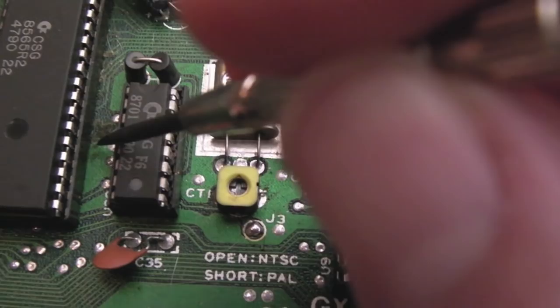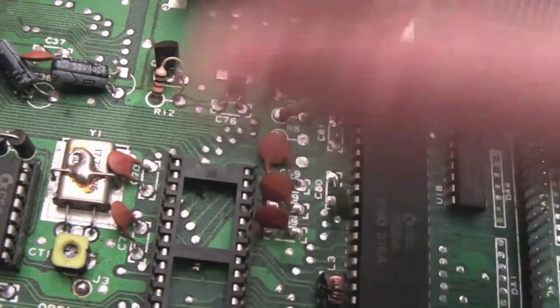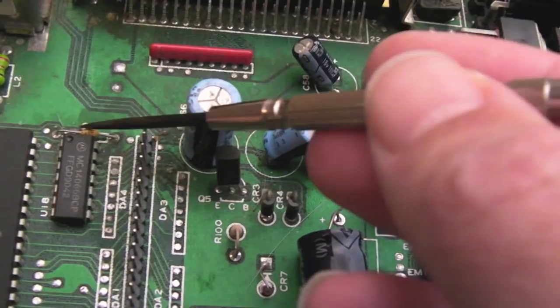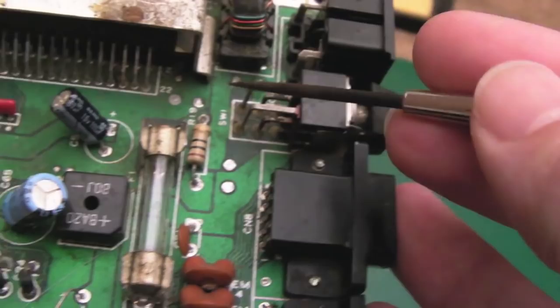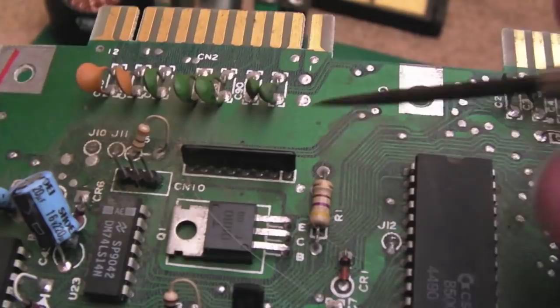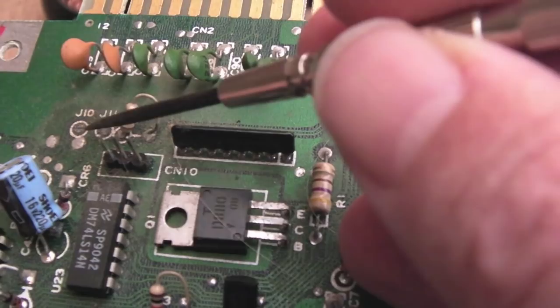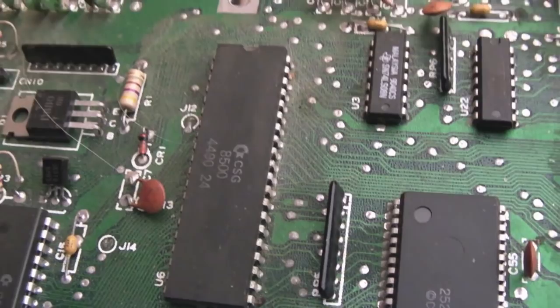Just moving around the board you can see some corrosion next to this clock generator chip on one of the wires - could have a corroded wire or something. Some more corrosion around here where the SID would have been, so someone's obviously nicked the SID off this to use as a spare. A load of corrosion here around the cart slot and dirt - looks like moisture or liquid. A lot of corrosion up here as well. These jumpers here are pretty bad; this could even be parts that are supposed to be split actually joined by the corrosion.